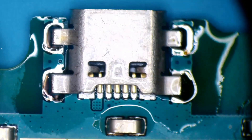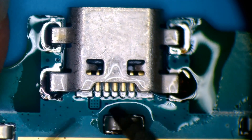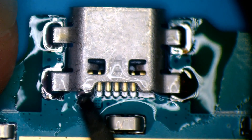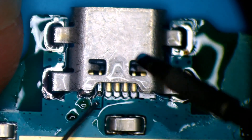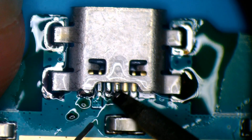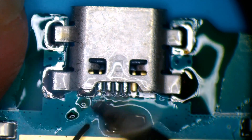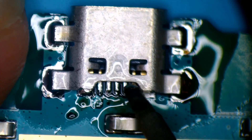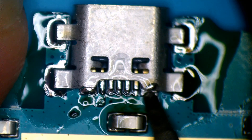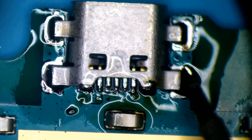We're going to do this with our soldering iron. Try to get a small tip — that will be easier for you. We're going to go one by one on these pins, just welding each one to the motherboard. Just make sure not to join them — when you apply solder, make sure all the pins are not making contact to each other. That could cause a short on the phone when you plug in the charging port. So just make sure you weld every single pin to the pads, but not to each other.